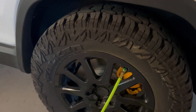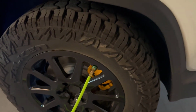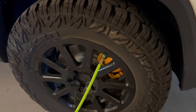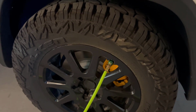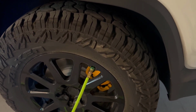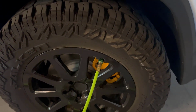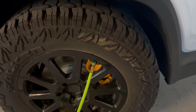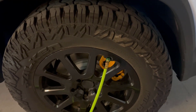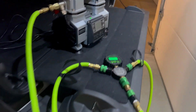The main thing, again, that's not really recognized is when you have 4 tires connected up to one pump, you're basically increasing the efficiency of the pump, because a valve stem is the main restriction preventing that pump from flowing all the air that it possibly could. So when you have 4 valve stems open at once, you're able to get a bit more flow, and therefore a bit more efficiency is what it's been shown to do. So it's not just the pump that's going to help you.